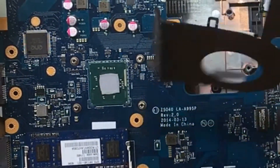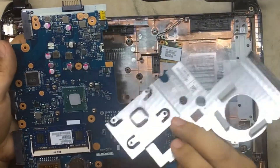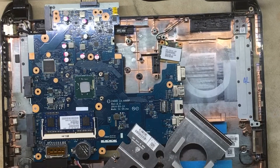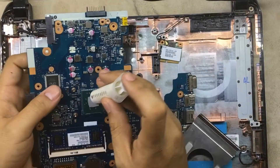So that's it — this tiny, lightweight piece of aluminum with no real mass is supposed to cool down your CPU. What I'm going to do is place some thermal paste. You can use whichever you want — Arctic MX5 or MX4. I'll place MX4 right now. This came in for a hardware replacement and a service.